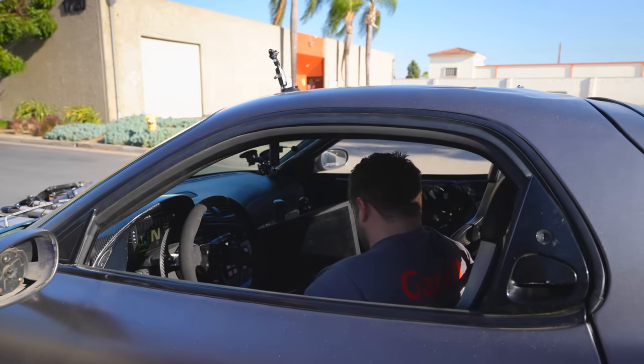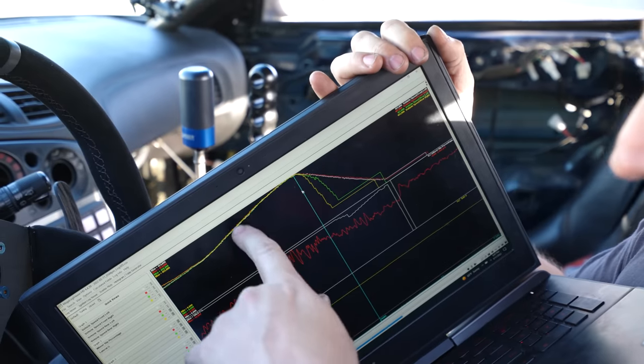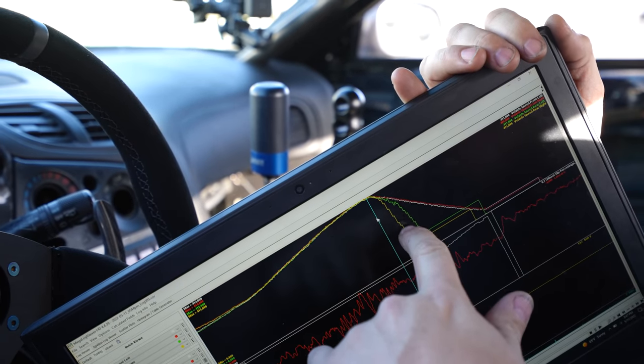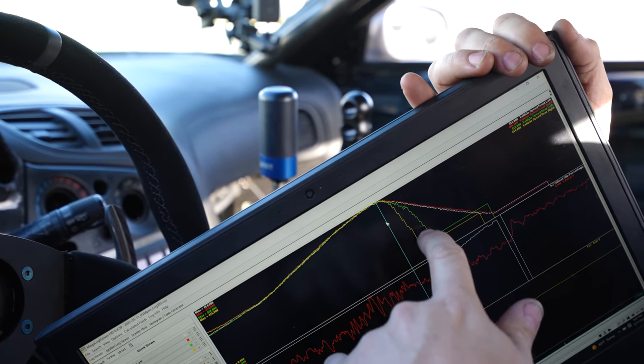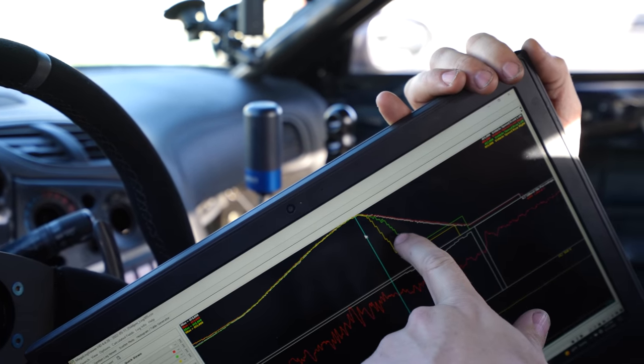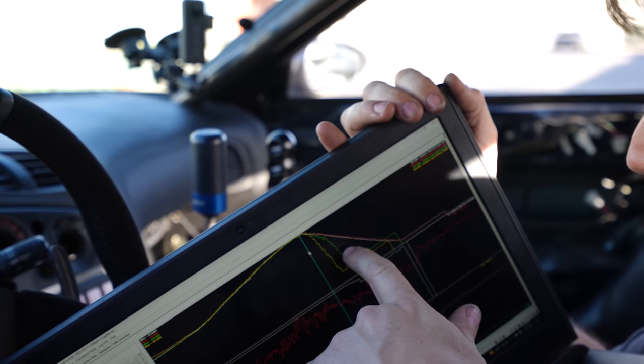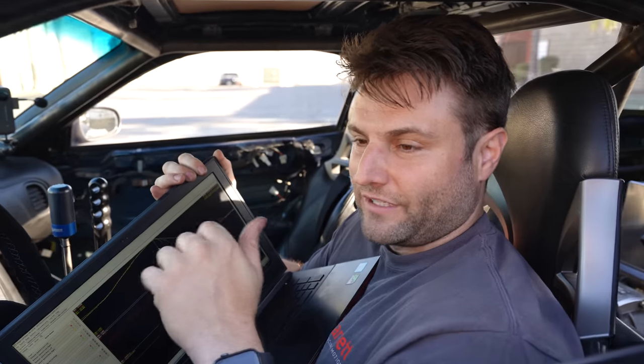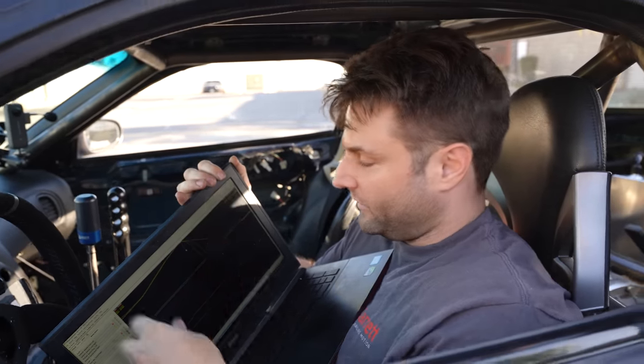Yeah, so your rear left locked up first. Very interesting. So here we are, all four wheel speed sensors, and then slam on the brakes, and the yellow and the green stop first. Yellow being rear right, green being rear left. So the rear is locked up way before the front, which is bad. You want the fronts always to have a little bit more grip, and if you lock the rears, the car can go sliding like this, where if you lock the fronts, you have more control over the understeer and stuff like that.